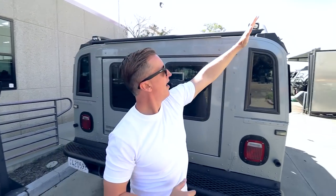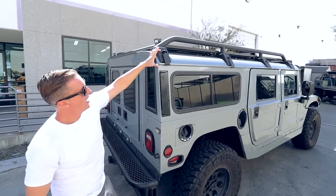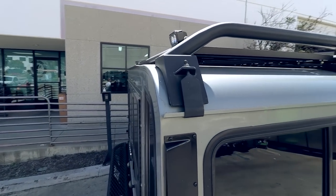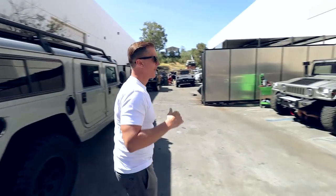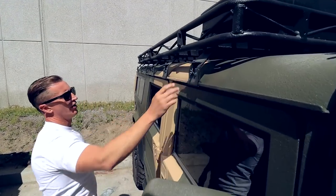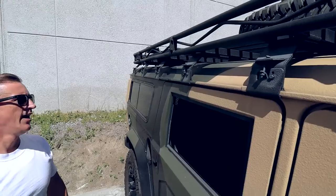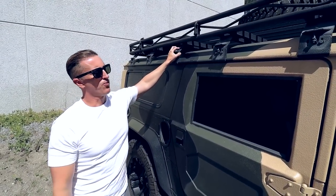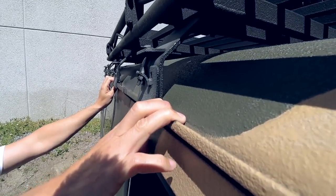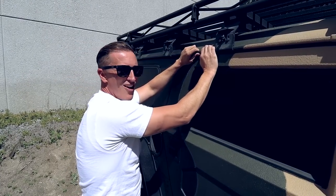Coming back over here on the clamps — this was our initial design. Once we switched over to this style mount, it was one bolt on here, a smaller clamp, and that has been fully upgraded and replaced. But right behind me, take a look at this. This is a traditional basket-style roof rack with the rain gutter clamps right on here. Very easy to work with — you can actually buy these clamps. I think a company called Confer makes some, and you can build your roof rack and just bolt it on. The problem is the entire load is actually weighted on the rain gutter itself, and you have two panels here seamed together — it's not the strongest point of the roof.